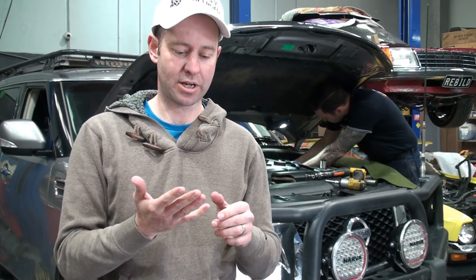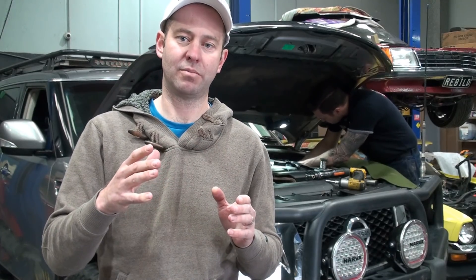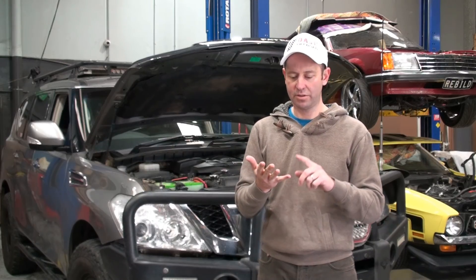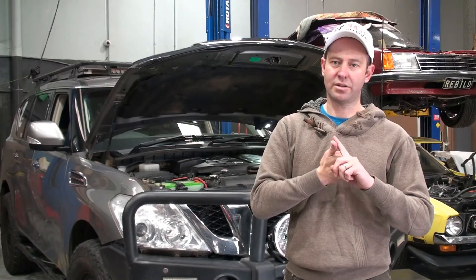So let's talk about real-time tuning. That means it's on the dyno, the car is under load, and then you can change the air-fuel mixture and timing at that moment. We can set it at a speed, have a look at the torque and power output, and then change the tunes to suit towing or suit four-wheel driving. We can change the throttle positions. When you're four-wheel driving over the moguls and the throttle's too touchy, this will back it off in the four-wheel drive setting — similar to putting it in rock mode — and it gives you more tactile response on the throttle. We're going to do it before and after on the dyno and I've gone for the five-map selection tune: one for power, one for 95, one for 91, a four-wheel driving map, and a towing map.